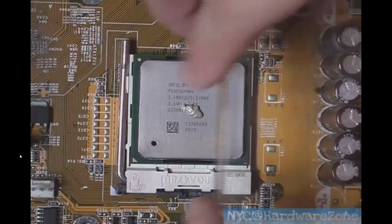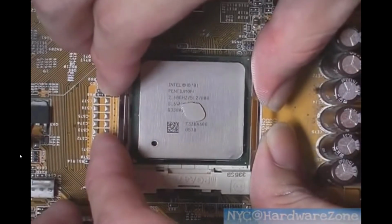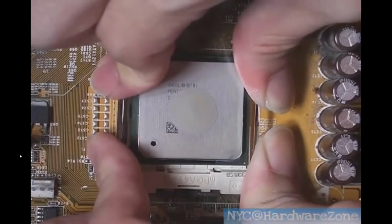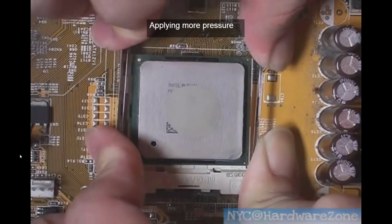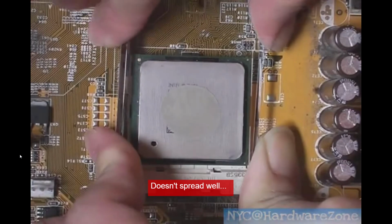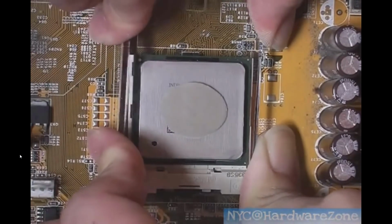So look, this is old school Arctic Silver 3. As you can see, this one does not spread out as far. So depending on what type of CPU, because sometimes the actual CPU die underneath the heat spreader is a small little bit, that might be fine. But in other cases, that won't be enough at all. So again, it depends how long you've been doing tech.